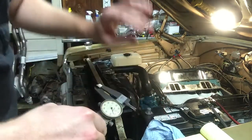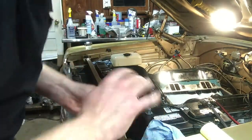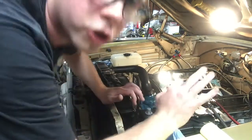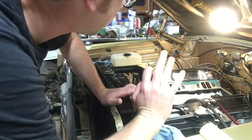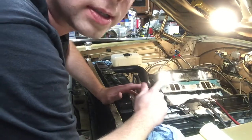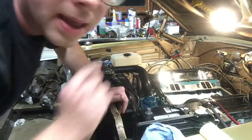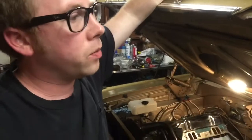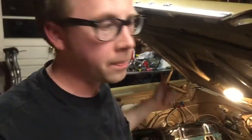I've got 28 thousandths on the top and 26 on the bottom, so that's two thousandths more on the bottom. Write it down and go all the way around. We're shooting for six to eight thousandths more total on the bottom. So I've got two thousandths on one side — I'm looking for four to six thousandths more crush on the bottom on the other side. Before I sent this intake out, it was eight thousandths the wrong way — eight thousandths less crush on the bottom than the top — and that's why it kept sucking oil.